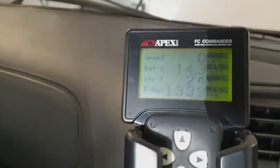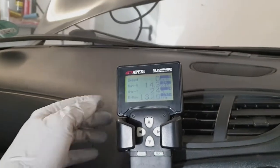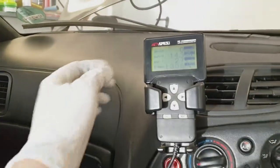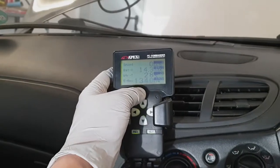On the PFC, I added speed because the gauge doesn't work, and battery monitoring because of the ground issues. This car has a Viper alarm, and if I leave the battery connected for certain days without turning it on, it will drain the battery — so I had to figure that out. I like to check the voltage of the battery, the water temp, and temperature. That's what we want to focus on today.